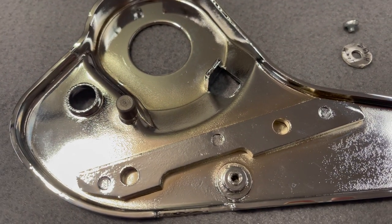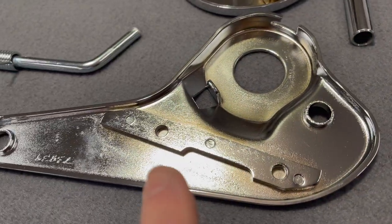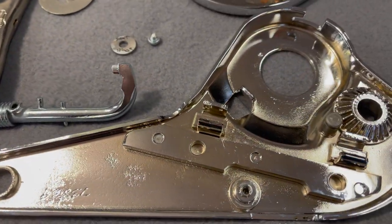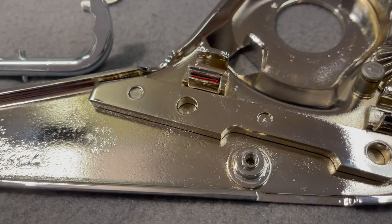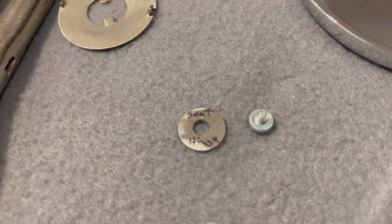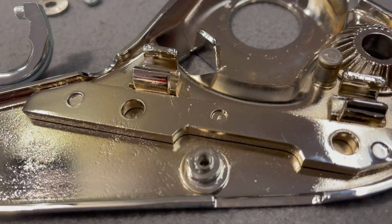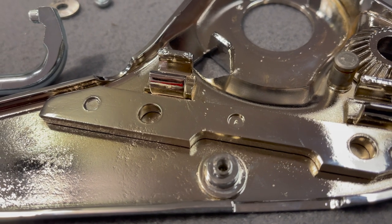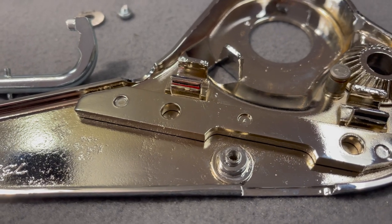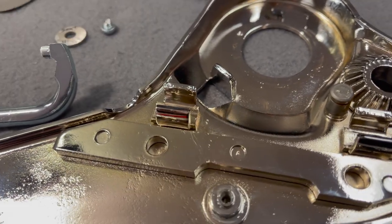Subtle differences between the passenger side and driver's side here. This is going to be the left hinge of the passenger side. What's different about this is this setup here — we don't have that on this side. So if you see those, you're definitely working with the passenger side hinge. I had to take a die grinder and buzz off the washer that was holding that down. I made a custom screw to be able to put this back together. Otherwise there's no way to really put it back together — you'd have to weld it, which would destroy the chrome work, or use epoxy, but I don't think that would be strong enough.